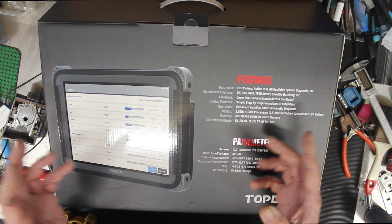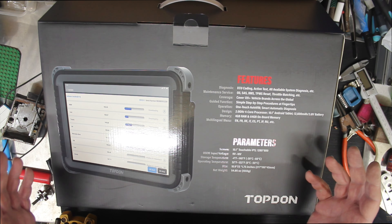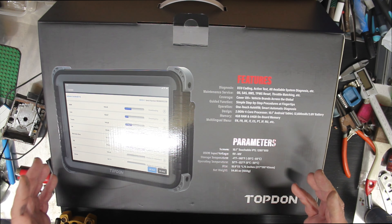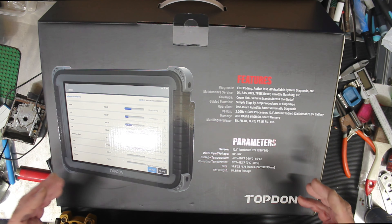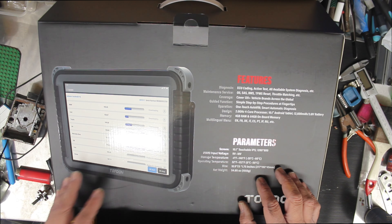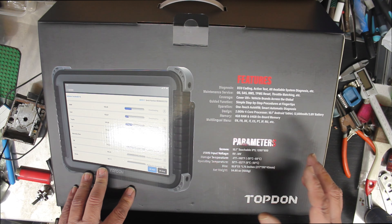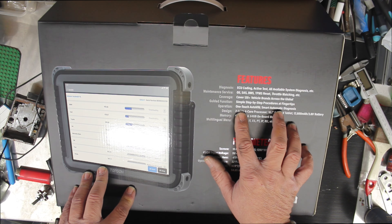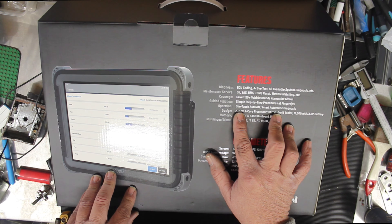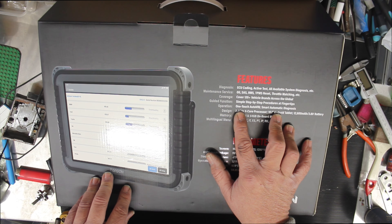With these types of tools, they're a lot more specific — you need to know the exact make and model. I found that you go through a few different makes thinking it's one when it's not. You've got to have the right model to talk to the car, so it's always good to check your VIN before trying to hook onto it and communicate with it.